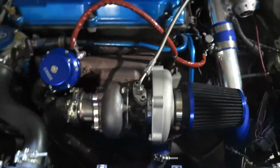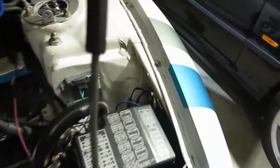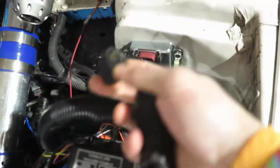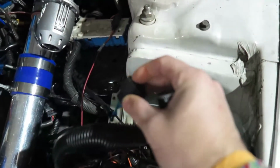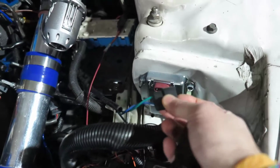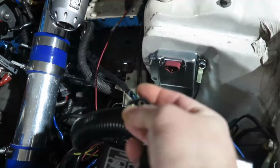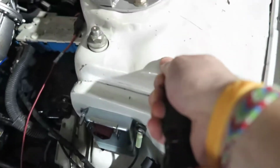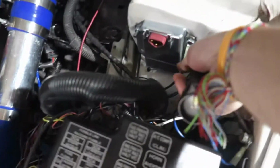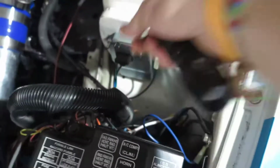So yeah, pretty much, if your battery is not charging, don't replace your alternator. There is a way: if you get this thing here out of the way, and put a wire here, run your car, put a wire on, not on the positive, of course, which is, again, the top of the triangle. The other one is the field. Put a wire on the field, and then as your car is started, you touch that field to some metal in your car, you're gonna hear a difference in your engine. That means your alternator is charging.